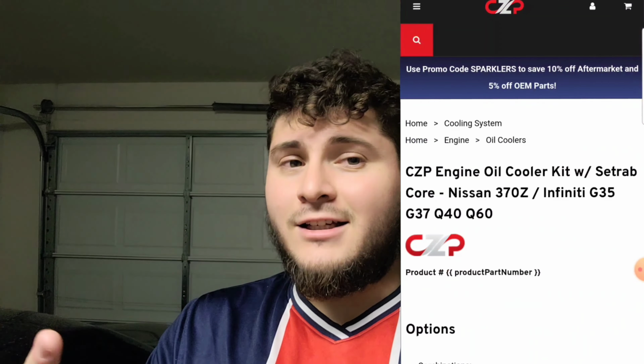I'm gonna leave a video right here of me driving my car. But when I'm driving normally, I'm just cruising. I'm usually averaging about 180 temps. Once I push, it gets closer to 220. Now before, when I didn't have the oil cooler, I'm not even playing around, I was getting close to 260. So the temps were getting over 240, getting close to 260. But now with the oil cooler, I don't ever go over 220. I have not seen it go over 220.